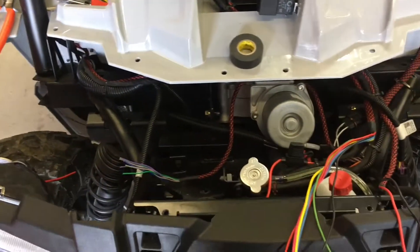I'll get everything semi pre-wired and go from there. Connections going into the fuse block will have additional weatherproof connections - just spade terminals. For the fan relay override, I'll have extra loop wire zip-tied out of the way. The CVT fan will have a disconnect. My plan is to run everything this way so I can pop the fuse block - it's mounted on angle iron with two bolts. If I need to check brake fluid I can pop the fuse block off, set it aside, then fold it back in.